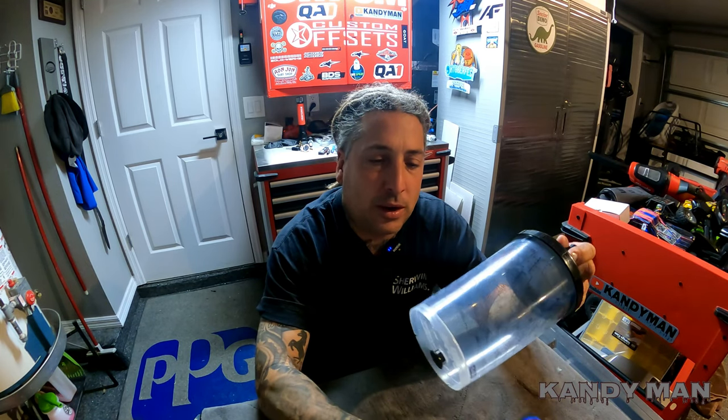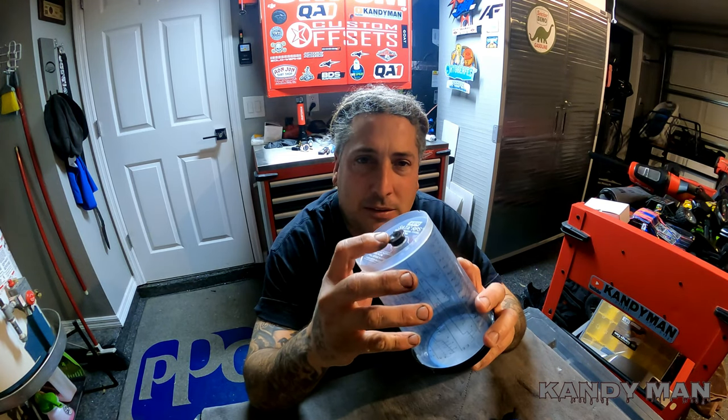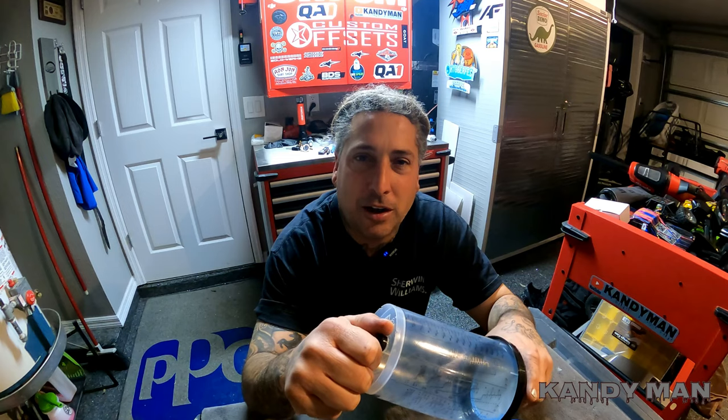The only thing I didn't really care for — and it could just be that I'm not used to them — is these cups. They seem kind of weak. I'm used to DeVilbiss cups and PPS, and these feel like if you hit something they could crack. But I could just be thinking that because I'm used to harder, stronger cups. It didn't have any problems spraying. The other issue was the vent cap on top — when I went back to mix more clear, I didn't realize I had to close the vent. That's basically user error on my part. But all in all, really good gun — I really liked it.